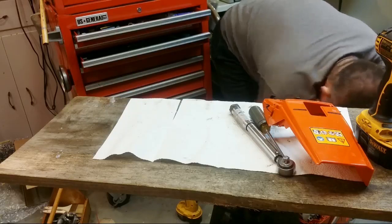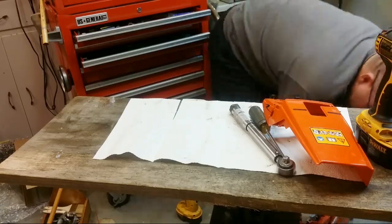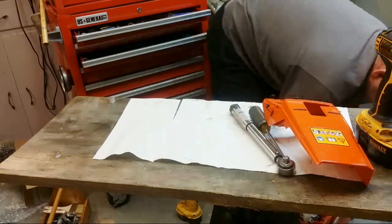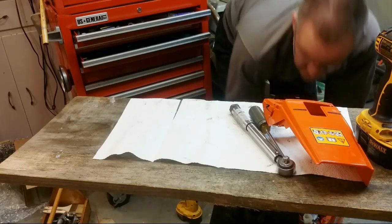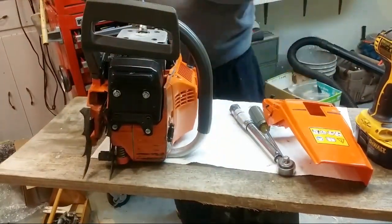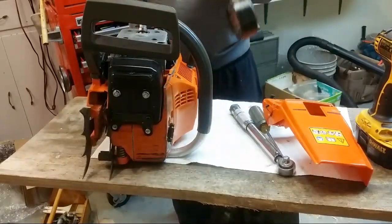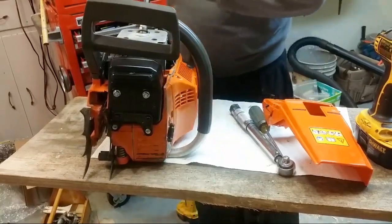So about the same, just a little less than 150 there. That's 180 something. Remember, that's completely dry. There's no oil in there or anything. So that one's 170-ish. This one's about 180. A little bit of leak down there. You can see that. So this one's got a little higher comp.